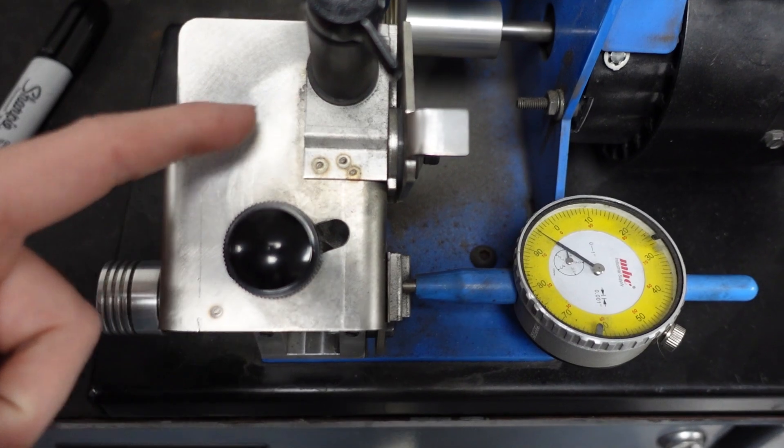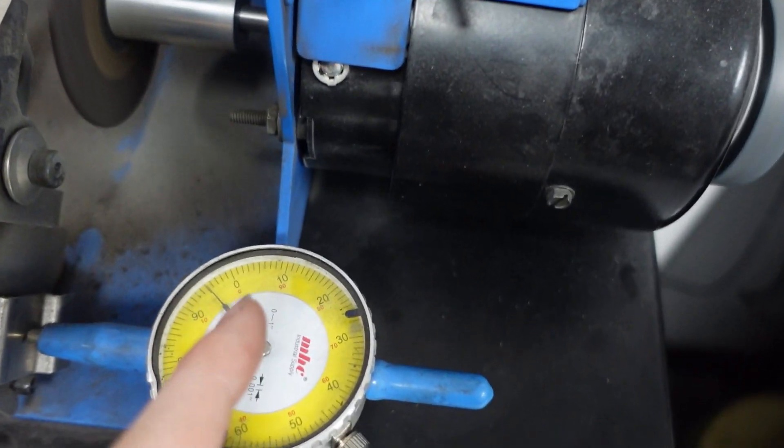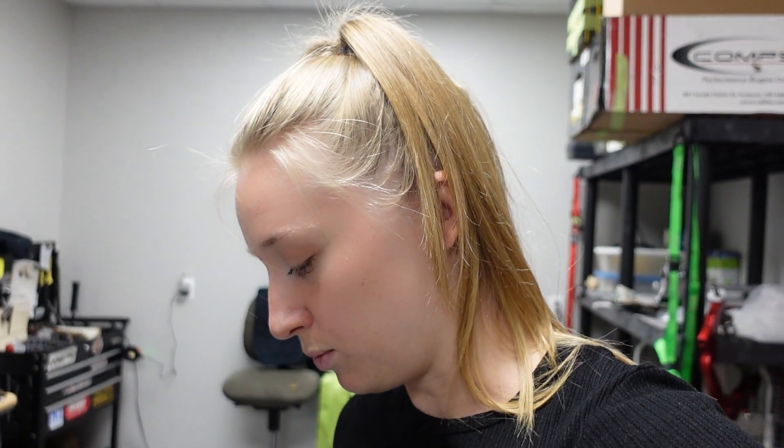Because when there's a light shining through it, you'll see if there's any little mistakes or if it's slightly crooked, to make sure it's perfectly straight. We are using this machine right here — we put the ring in here and slide it on the sander until it hits zero. You also want to bring it over to this polisher/sander and make sure all the edges are polished down on the sides so they're not sharp. Because if the edges are sharp — since sanding creates a perfect 90-degree angle on every edge — you put these rings back into the cylinder and it will end up scratching it, which creates metal dust and debris we don't want in the engine.